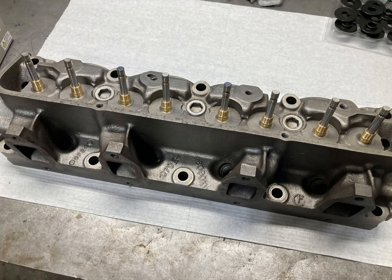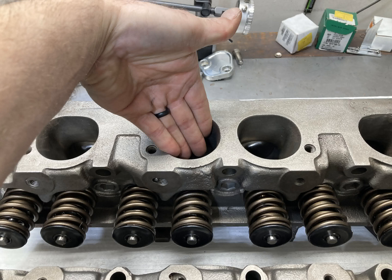For the cylinder head side, we are using factory tunnel port heads that have also been baked and tumbled so they look like new. Bronze valve guides and 11/32nd S-I stainless valves bring things up to the modern era — not using the heavy 3/8 stem stuff. The cylinder head is one of the biggest components of making horsepower, so we need to treat it right. Here's showing the size of the intake port; we've also got Comp Cams valvetrain with 930 springs.